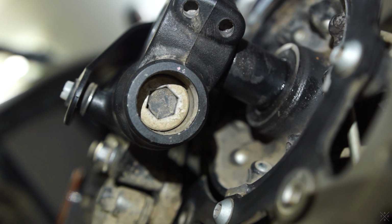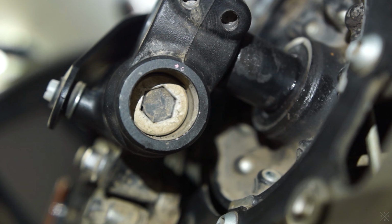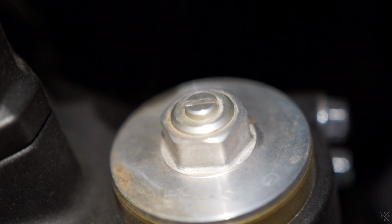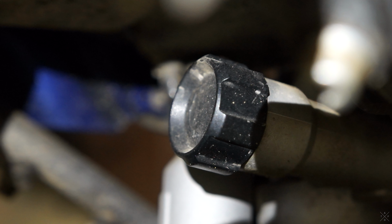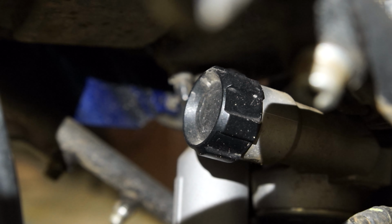I adjusted the suspension settings to my liking. Actually, I decreased the damping in the front to reduce vibrations on double trails and increased the rebound on the front a bit. Also, I compromised on reducing the preload on the back to reach the ground better on slower trails.